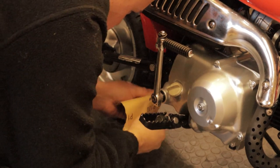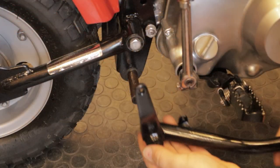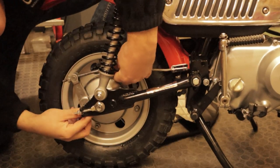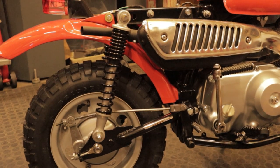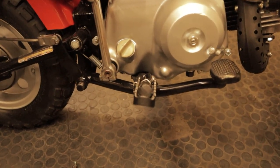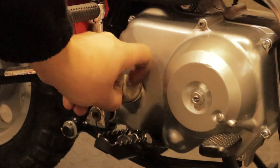Really making our way through these jobs now, and one I was keen to do was the rear brake setup. In a previous video we had an absolute nightmare with this brake drum — the brake lever being seized to it. So it was really refreshing to rebuild this — OEM and it looks great. We start assembling starting with the brake pivot, then we work on the rear connecting rod — ideally you'd fit it to the wheel prior to it going in the frame, but we got around it by loosening the rear wheel off. Then you put your clevis pin in, a few split pins, and it moves up and down with a lovely feel and nice spring back. To finish the rear lever off, all we need is a washer and a split pin to stop the brake lever sliding off. I took a spacer off the shelf, took a bit of material off the inside so it fits nicely, polished it up — that was a job well done.